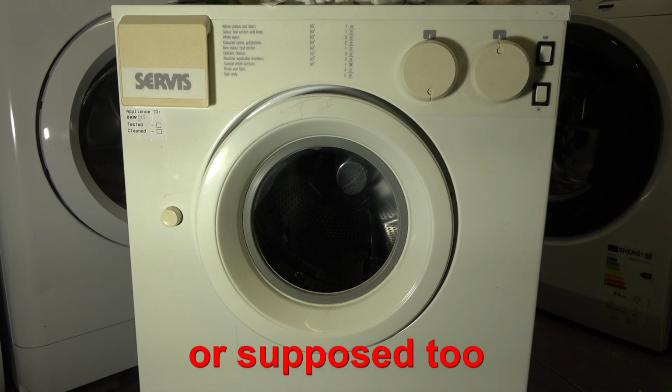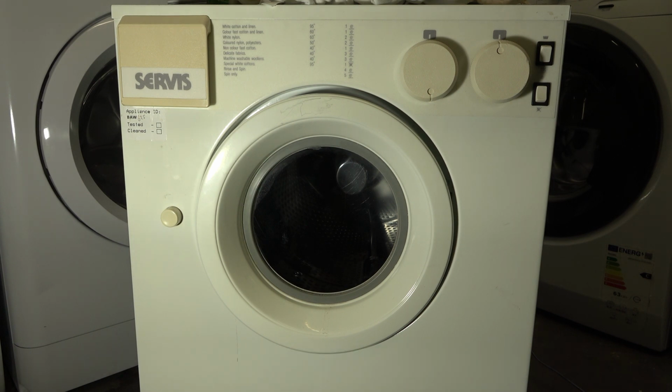So let's give this out of 10 then. Well, it's got another fault as well. I added the detergent to the main wash after we started, when it hit the main wash, because on the pre-wash, it will take on water and put water into the main wash compartment at the same time. Well, that's not very good. So it's got little problems here and there. But it's also incredibly quiet in operation. I was quite staggered really how quiet it is.